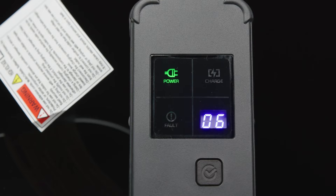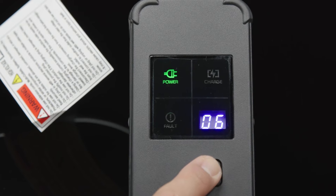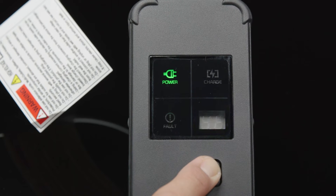The portable charger can match the charging amps to the level of electrical current supplied by your outlet. Press and hold the front button on the portable charger for two to eight seconds, then press the front button to cycle through the charging amp levels.